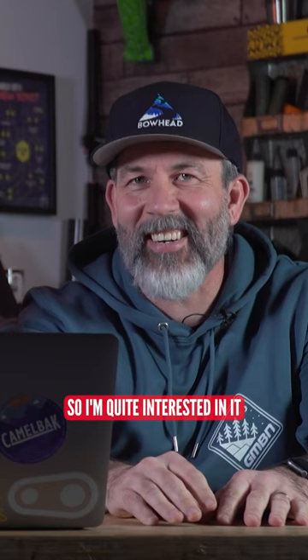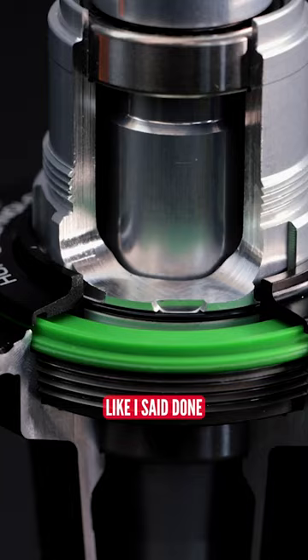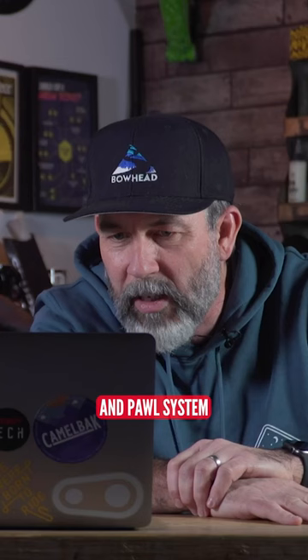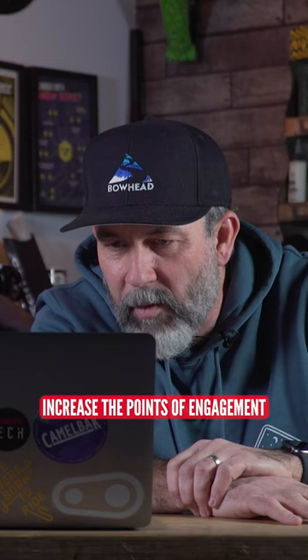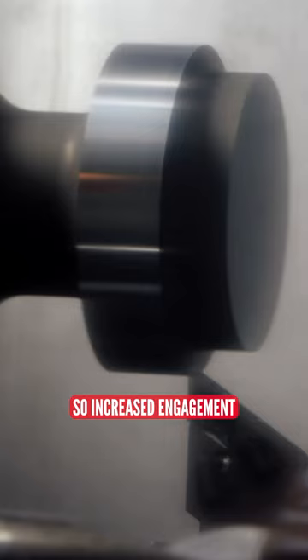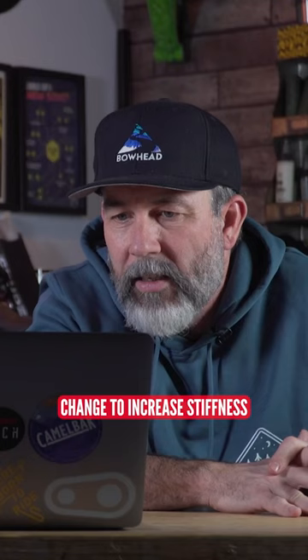I'm quite interested in it and I want to hear how it sounds. Here are some of the details. Main aim to improve the drag, done by upgrading the sealing with a new zero drag labyrinth seal and an improved ratchet and pawl system. Increased the points of engagement from 44 to 108 using an offset six-pawl freehub design, where three pawls are engaged at any time — increased engagement without sacrificing reliability. Shell profile changed to increase stiffness without added weight. Also takes bigger bearings. As always, fully serviceable and rebuildable.